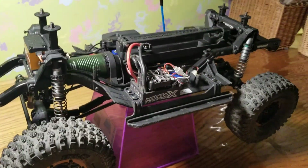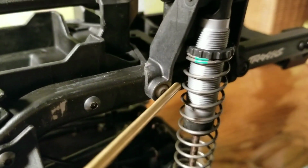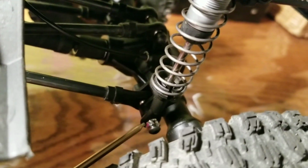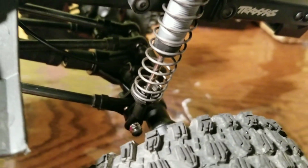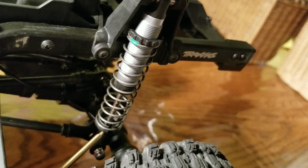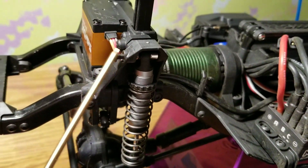Like I say, I did that to the back of this thing. There's a 3mm bolt hole directly behind the shock. If you take off the shock, you can see it. And that's how I have it done. I have these rod ends on there. That's what they look like. The longer ones fit on there with the stock lower spring cup. That's the shock setup. I need to tighten these bolts right here.